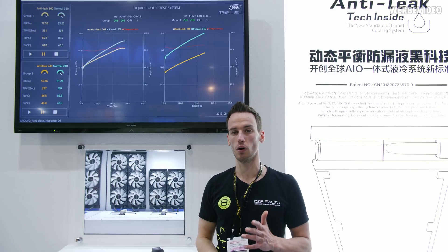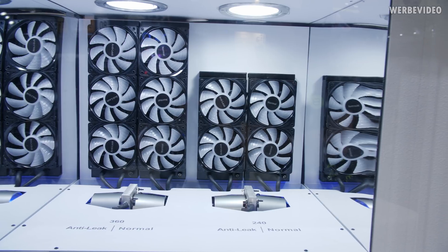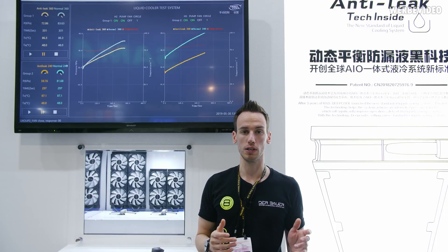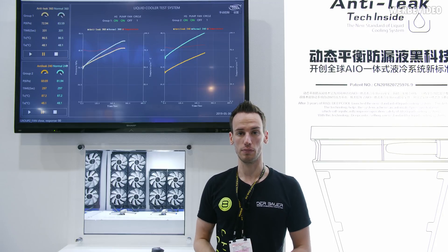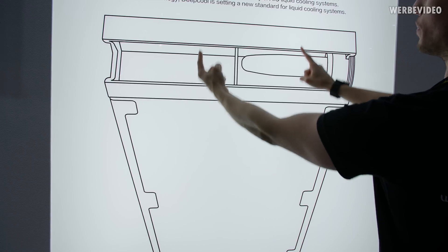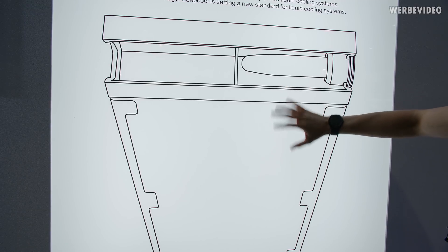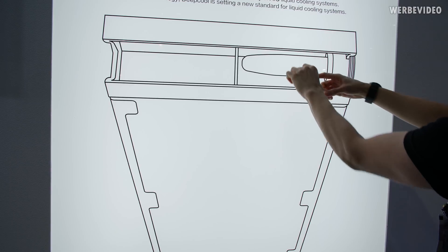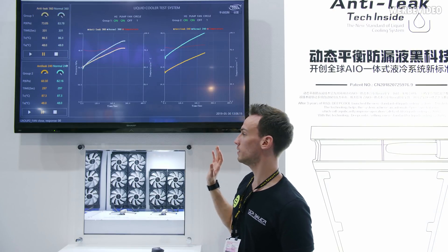That's a temperature you typically don't reach inside your AIO, but when the water is always expanding and shrinking you always have stress on the material — especially the radiator. After two or three years and a thousand temperature cycles, it could be a problem that your AIO starts to leak earlier because of material stress. Anti-leak technology can therefore be positive for your system and for AIO lifetime. Looking at a normal AIO radiator — in the top area there is a rubber tube that looks like a finger of a glove. As pressure increases, it compresses this rubber finger, providing a different volume so the pressure doesn't increase nearly as much. Deepcool has a patent on this.